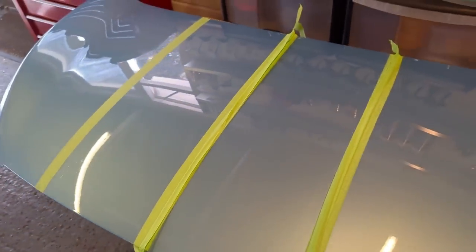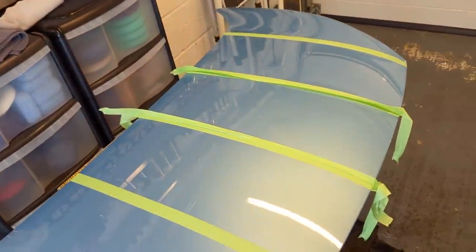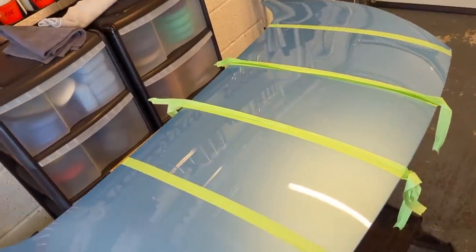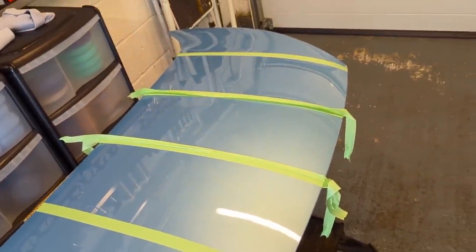Okay. We've got polish. I've got polish under the tape. No, we've dry buffed before, so we should have just polish residue under the tape. Under the tape is irrelevant. So what we need to do now is wait 1 hour, and that'll also give a chance for any panel wipe residues to vaporize away. So 1 hour is a good thing.